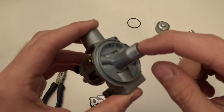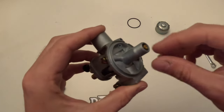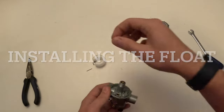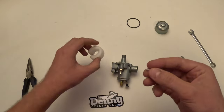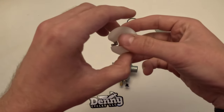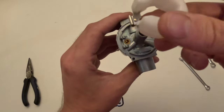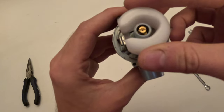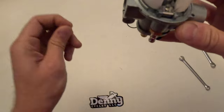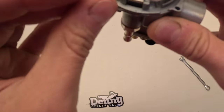What you want to be able to do is replace the main jet without the atomizer pulling out every time. You can see we got it back in there. Our next step is to install the float — take the float needle and slide it in the little groove on the float. You have to be pretty careful here; make sure it holds in place while you drop it down. The float needle tip will go right down into that brass part. Just slide it in and get everything lined up.